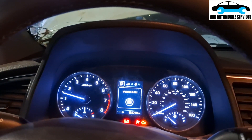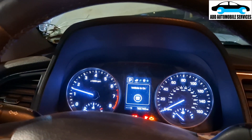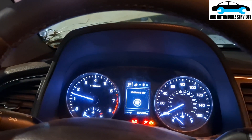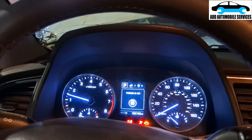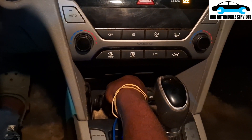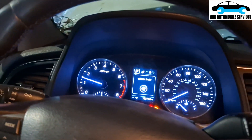What I'm going to do is go back to my wiring diagram and make sure I'm able to test the necessary things. I have to move to the fuse box and test the fuse and the relay. But for now the vehicle is running because I'm supplying power to the fuel pump and control module.